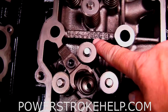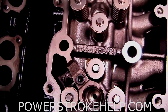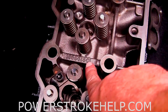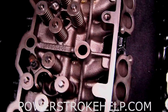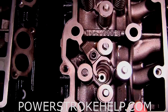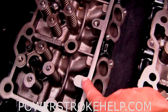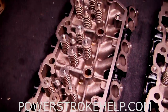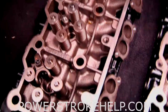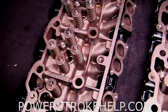To recap: all of your cylinder heads with the last five digits 080 — C1, C2, C3, C4 — they all interchange. Some of the 613C1 heads with 20mm can be adapted with the step-down adapter to work on a pre-commonized application, but in order to do that the 613 head has to have the smaller bolt hole, not the larger one. Anytime you put a rocker carrier on there that doesn't belong, you run the risk of not lining up the rocker arms correctly when you torque down the heads and possible premature rocker arm failure. It's very important to get these part numbers and types of cylinder heads correct so that we can ship you the correct type of cylinder head.